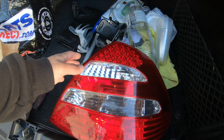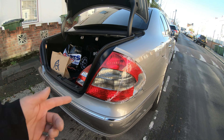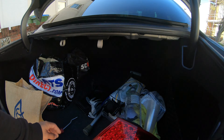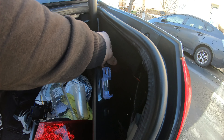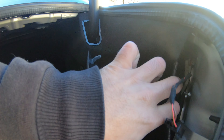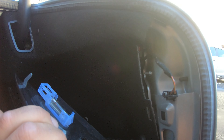We just said what's up to dad. First job: we're going to change this tail light. Dad's saying he doesn't know if he wants the other LED light — I would personally go for LEDs. Anyway, just use the quick trim tool, pull that back. Just noticed this wasn't even connected either. It's giving a nice little bit of access around here so we can get to the bolts. Looks like it's an 8mm — take the carpet away from there, undo that.